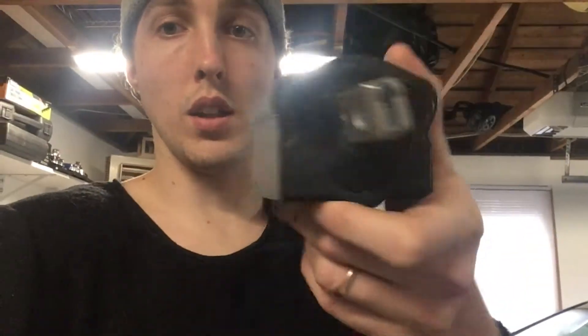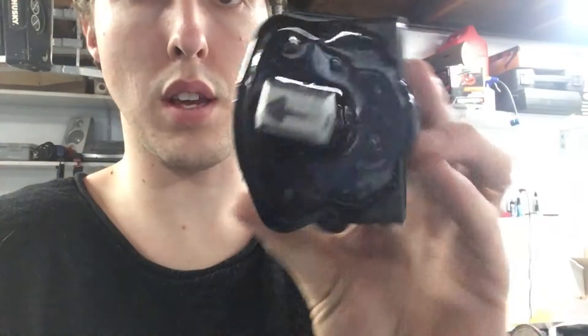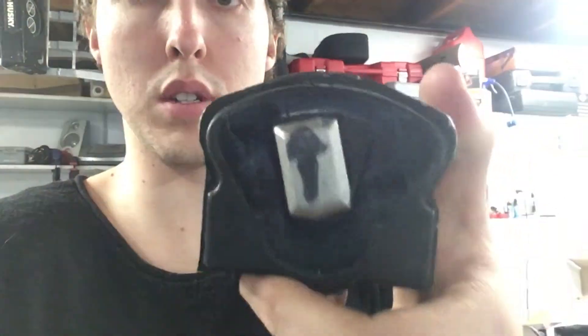What's going on, guys? This is Anderson's Garage. Today we're working on the C55. I'm going to be installing this transmission mount for any Mercedes or other cars with the 722.6 transmission. What I did is used an 80A polyurethane and filled this original housing.